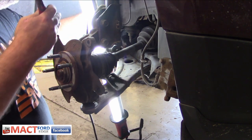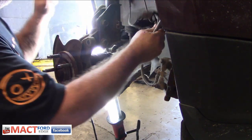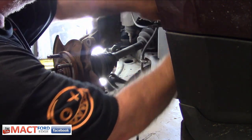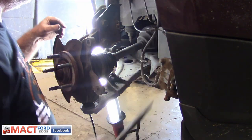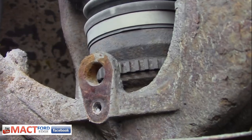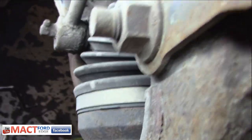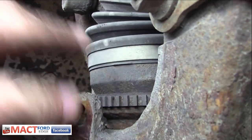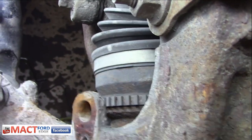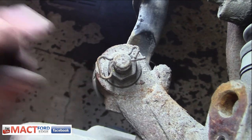I'm going to put that out of the way over here, over by the brake caliper where it's probably not going to get so much abuse. So I got that out — let me show you. You can see all that rust in there, but I got that wheel speed sensor out of there. Again, it won't be rusty because I'm not reusing this knuckle, but I do have to get this off of here, so I'm going to use those long nose pliers to do that.